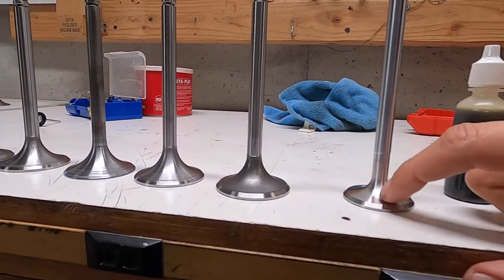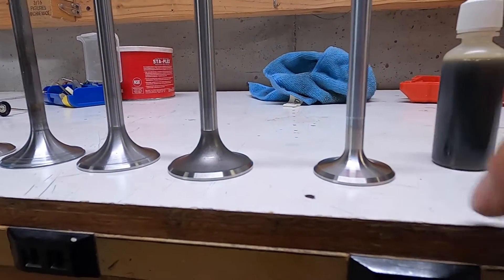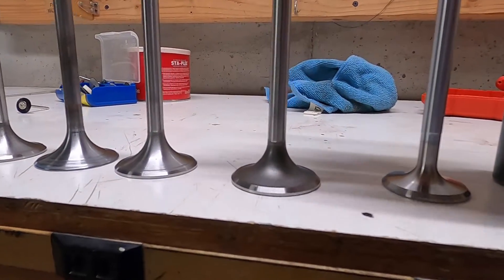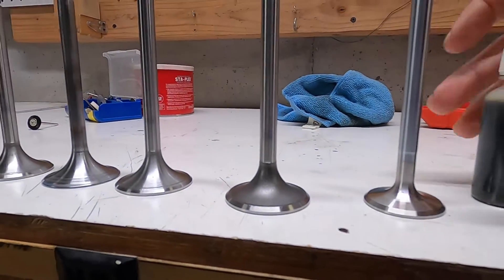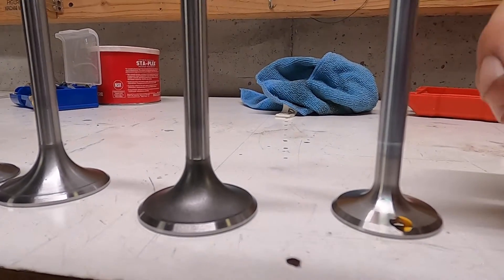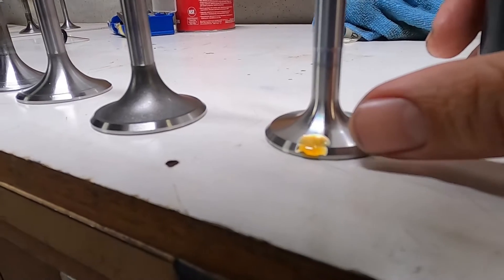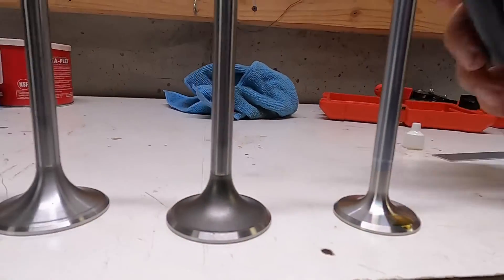What we're going to do is put drips of gear oil on each valve and look at how well it beads off. For this type of test it's important to have a clear winner — the performance valve — we know this flows well, and a clear loser — the stock valve. We know this does not perform as well. I went through a number of iterations to make sure this was going to be consistent. It's not a fast test; it doesn't have to be fast. It just has to be consistent.